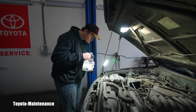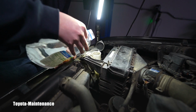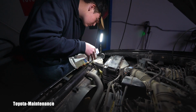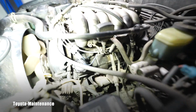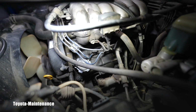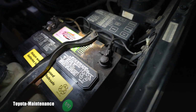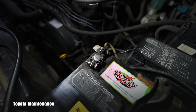While we are at these kind of fluids, Izaak discovered where his windshield wiper reservoir is, and he will top it with just plain water for now. Here we can see maybe one more time a detail of those leaks on those valve covers. It's going down on the exhaust, so there will be a problem with the smell. We just tested the battery. The battery tested good. This positive terminal was not correctly installed, so we fixed that.